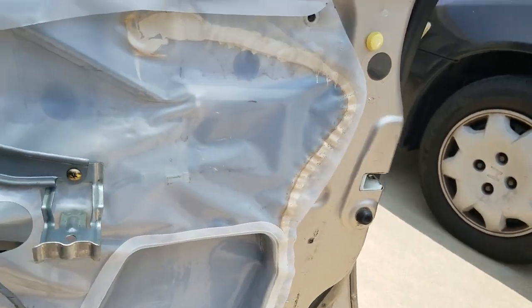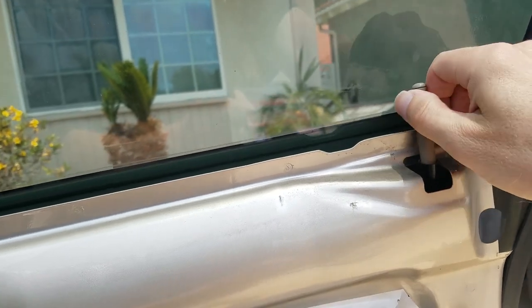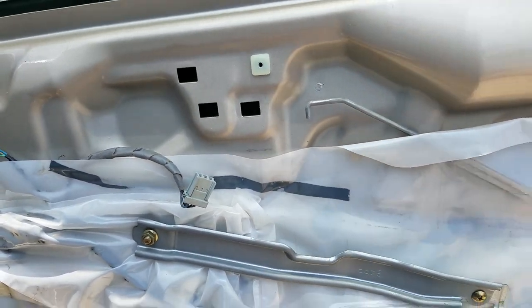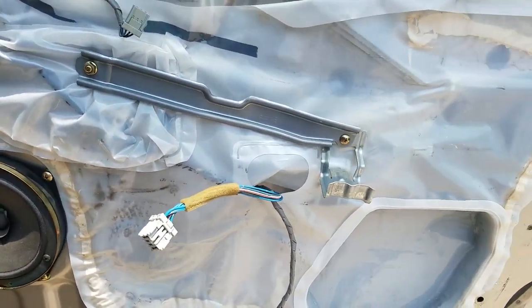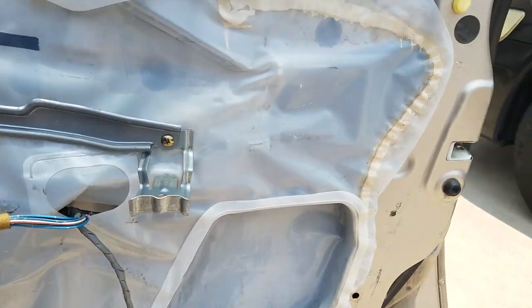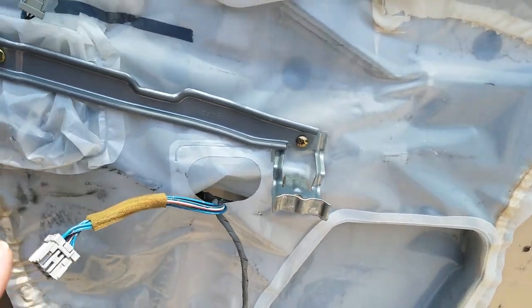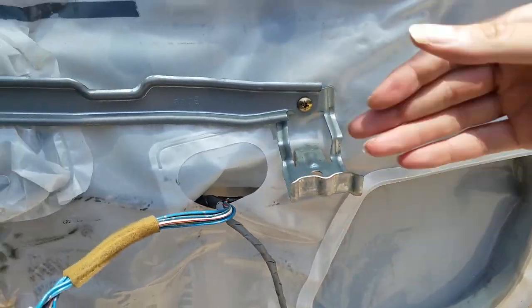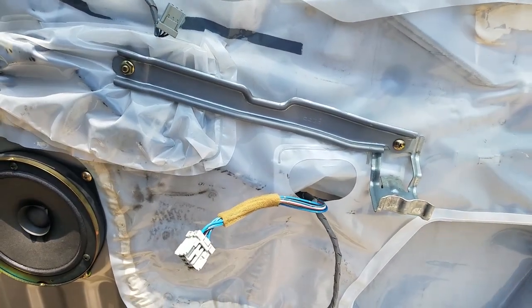Okay, I've got the door panel off. I've had these things off plenty of times just to do basic troubleshooting of the door lock — sometimes it gets stuck, so I'll take the door panel off to check the path. Here's the rod that goes to the actual door handle. So I'm not usually baffled by what I see under here, but in this case I was trying to find the actuator. I figured it'd be here somewhere, but it wasn't there. Then I thought maybe it's behind the speaker — it wasn't there either. I stuck my hands in and felt around, could not find it. I could feel the window regulator, the thing that makes the window go up and down, but could not find the actuator.